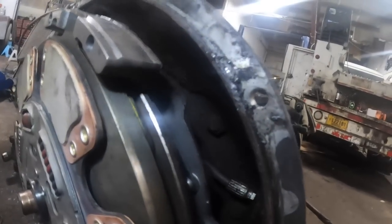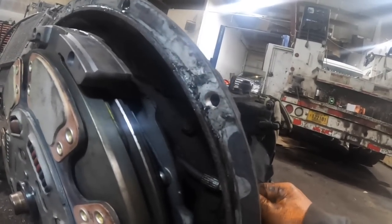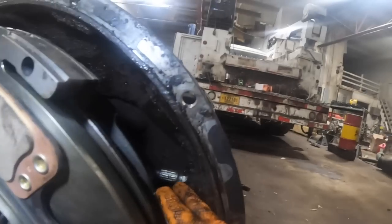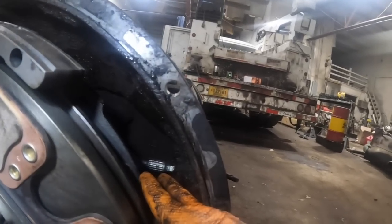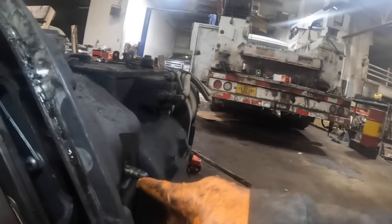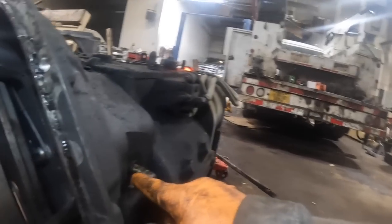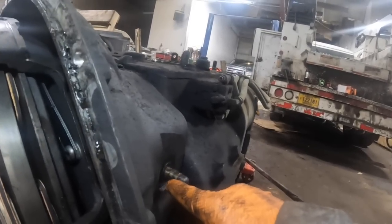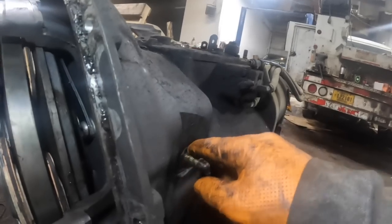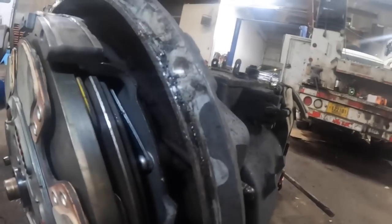And yeah, anyways, that's a number 4 JIC, and I put a number 4 female pipe here. It's number 4 hose to number 2, which would be 1/8 inch. And then I put a close nipple into that end, and then this pipe union with the washer here, and tightened it real nice and tight, and it worked out really good.